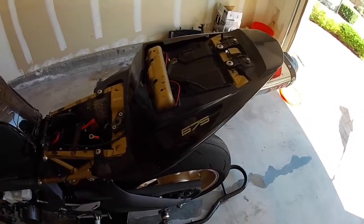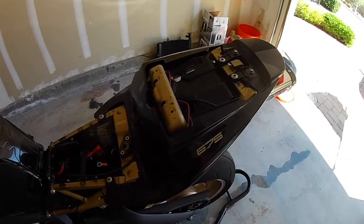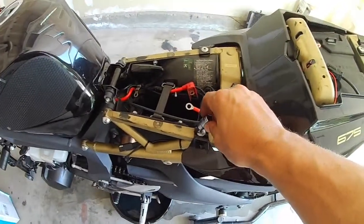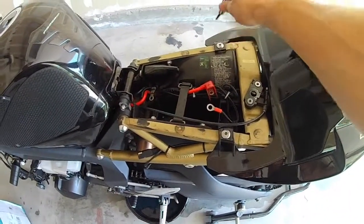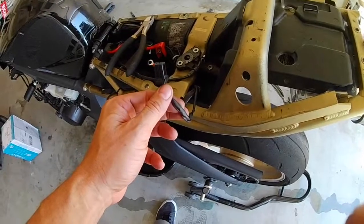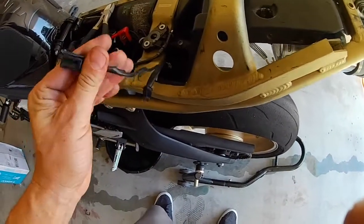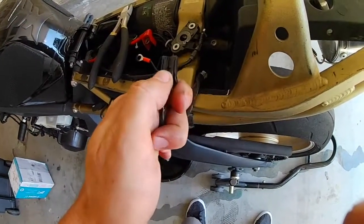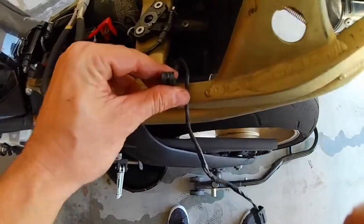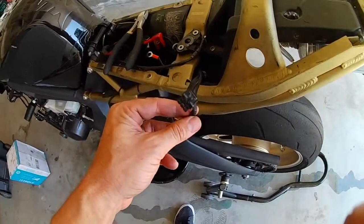In order to get the header off, it looks like I'm going to have to pull off the whole exhaust — I don't want to mess up anything, so I'll remove the rear section. You will need to disconnect the blinker lights and the brake lights; there are just these two connectors. They have a little edge right here that you push down and they pull out. They're actually keyed — one is a three-prong and one is a four-prong — so you don't have to worry about marking them because you couldn't plug them in incorrectly anyway.